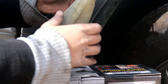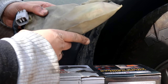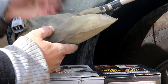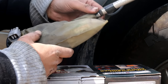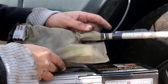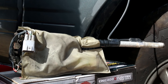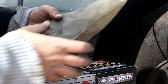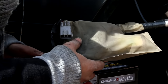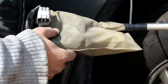This is mainly just to protect water from coming up over the top — it's not really supposed to be a complete seal. You don't want to seal it tight or else condensation is going to build up in there and you're going to ruin the motor that way. So it just needs to be covered down at the top — don't seal the bottom. Now we're going to put this back in. It's pretty straightforward — follow the same procedure in reverse, except this time you have a lot fewer clips because you broke most of them.